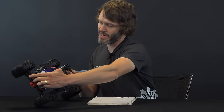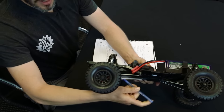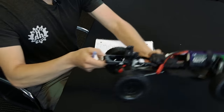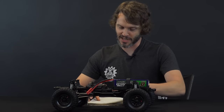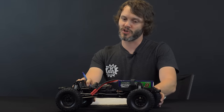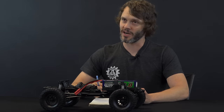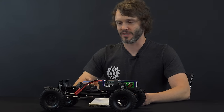Another feature to notice is the high pinion angle. The pinion comes in not on center to the axle but above center — that would be considered a hypoid gear. It is a lot of design work to get right. I'm sure they probably spent a couple hundred hours engineering that properly. I've tried to do my own bevel gear set myself and it is very difficult. So congrats to Axial on getting it right. It's a very smooth rolling axle. I thought it was going to be more bindy, more like a worm gear, but it's very smooth once everything is seated.